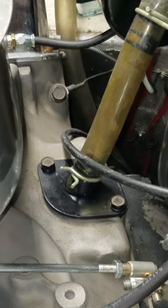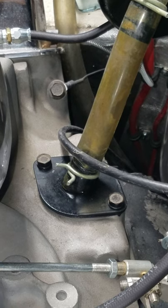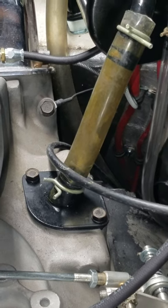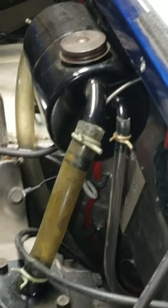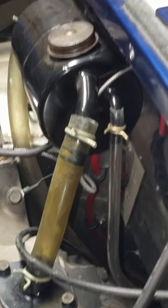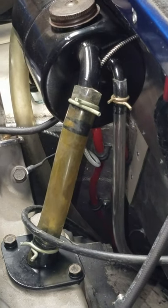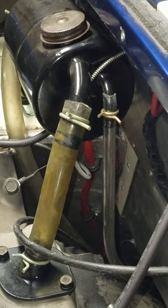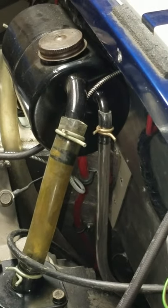You can see we have the puke tank breather hose mounted to the back of the intake manifold. We've got constant tension clamps connecting the breather plate to the puke tank. There's the first big one — the three quarter inch hose that goes from one to the other. Both of those tubes on the puke tank and on the breather plate need to have a bead on the end of them so that the constant tension clamps will do their job and not slide off the oily hoses and hose fittings.